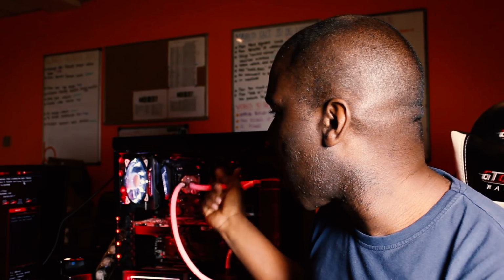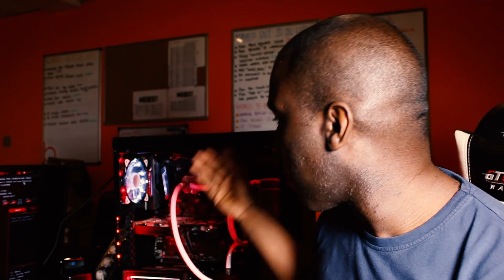And then I added two be quiet 120mm fans at the top, but I reversed them and started blowing air onto the VRMs and the chokes, because when I went to go over 4 gigahertz on the overclock, it wouldn't do it, even when I overvolted it and stuff like that. It wouldn't work unless I had more optimal cool air blowing over the system. So as soon as that happened, I ran through benchmarking like there was no tomorrow. It was really good and stable.